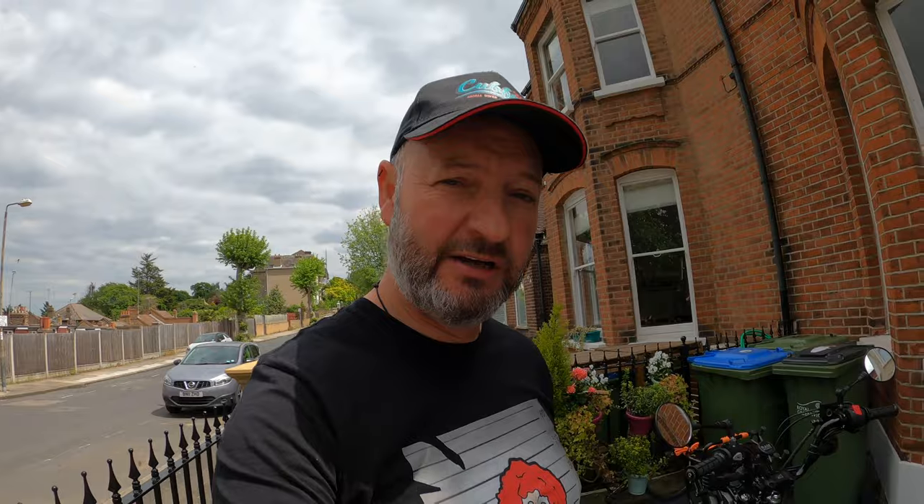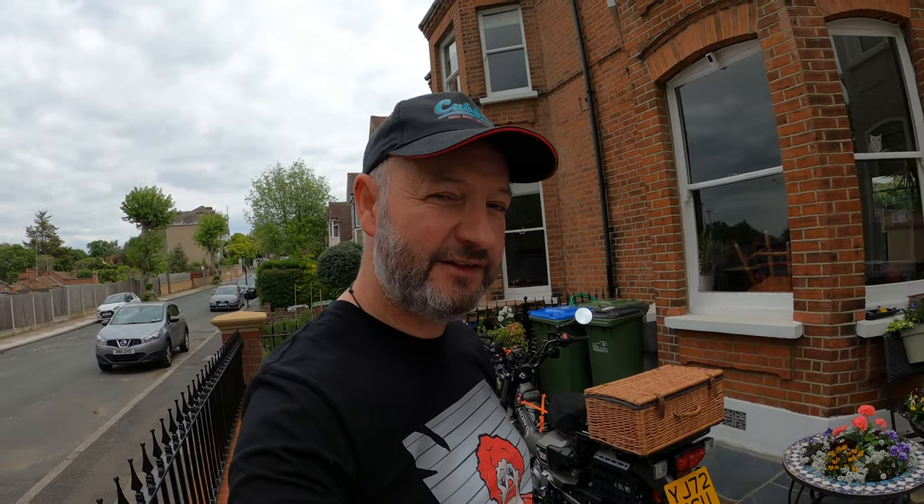The gearbox is a rotary system — starting in first by pushing down, then second, third, fourth, all down. Come to a complete stop, push down again and it goes back to neutral, going around in a circle. Please bear in mind the gen 2 has a completely different engine to the gen 1, including the engine mounts — a gen 1 engine will not fit a gen 2 and vice versa. Watch out for my next video when the 125 goes to a 145 cylinder kit, a cam, and a different ECU — looking forward to that one coming soon.